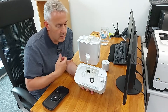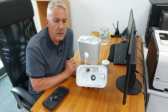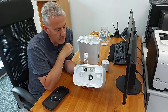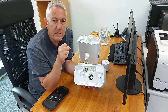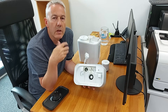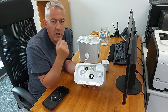This is where the action happens and the humidification happens. What you've got in here is the circle — that's your ultrasonic pad. What that does is vibrate really fast to chop the water up into tiny particles and you'll see the mist coming out once we turn the machine on. Here is our PTC heater — that's what warms the water up if we're doing warm mist, and you can see ours is covered in a good layer of lime scale. I'm going to do a cleaning video separately so you get a feel for how to deal with that.